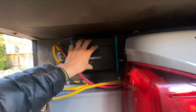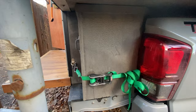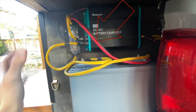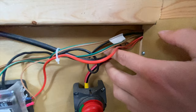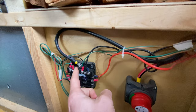Long story short, my starter battery with this DC-to-DC charger charges up my secondary battery. I have a little wooden piece that sticks back here, covers up the whole area, and I ratchet-strap it in — that's how I secure the battery. Just a piece of wood, ratchet-strapped, with a little handle and some weather protection. Basically, there's a red and black positive and negative jumper cable that goes through this wall from the battery, putting the power inside. You can see the black and red wires coming right through the hole there — the black goes straight to the negative. Negative from the battery goes into the negative of the fuse box.